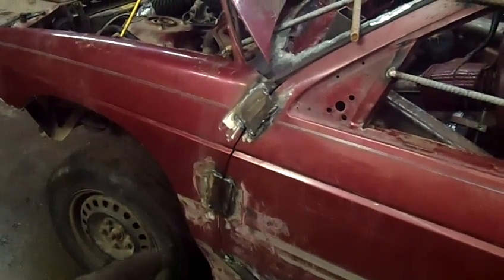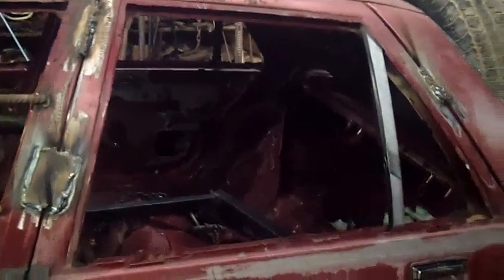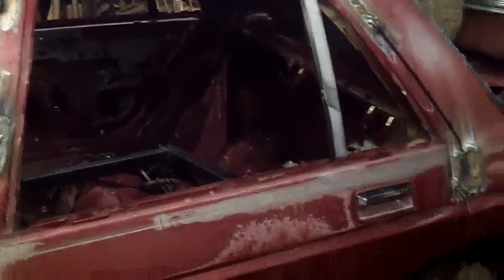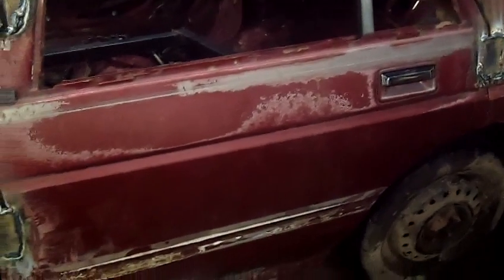But basically, I just welded 4 on, 6 off, roughly something like that, around the whole door. And it's still shut, so yeah. The rules, I believe, say you can do 6 on, 6 off, but I don't like to go too crazy with welding, because that's just money to me. But anyways, guys, the car is coming along quite a bit. It's just about done. I got just a few more things to do, and she'll be ready to get bent.